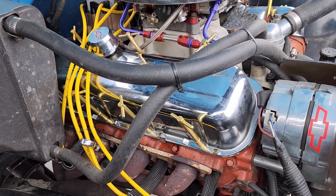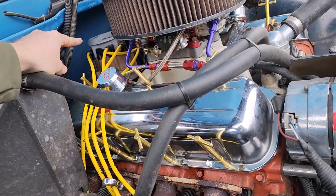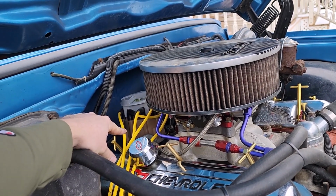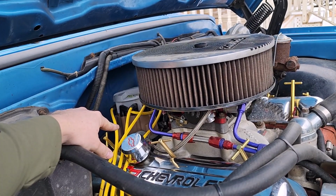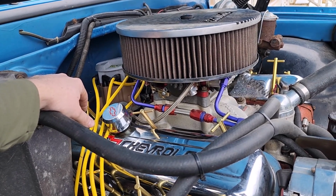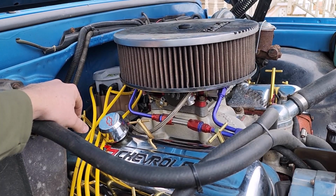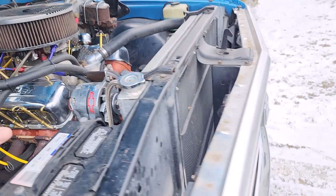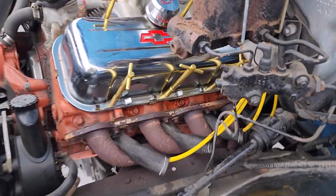What's actually wrong with her, because I fired her up and she's still not running right, is this distributor and cap. I need to put a new distributor and cap on it because the cap inside is rusted and corroded. It's still not firing right, so I'm going to have to get a cap and a rotor. And then next video I do on this, because I don't have time to do it now, I'll show you guys the new cap on it, and then we'll get it fired up and get a good sound on it. Hear it running good, because right now she's just not happy.